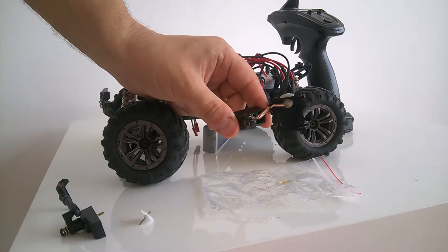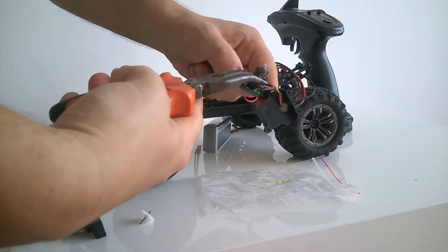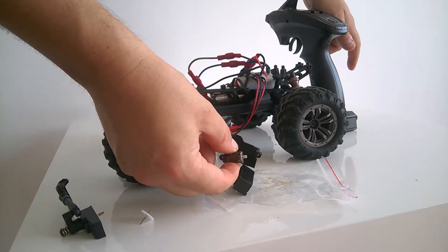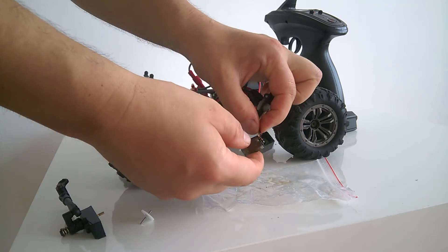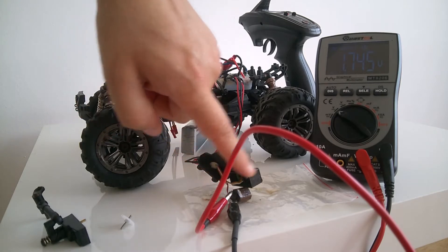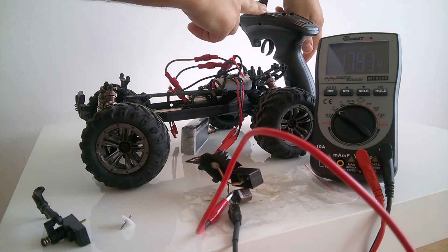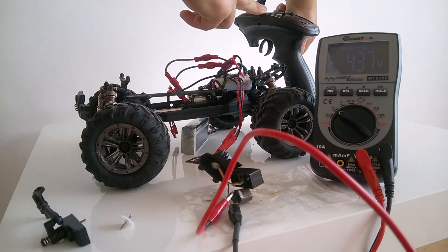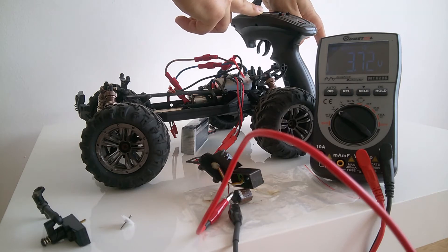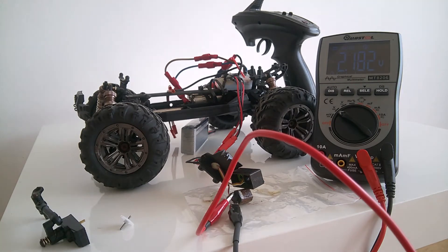Now I'll try to move it with the help of pliers. I can see a lot of rust and I'm sure the motor has been compromised. I need to check if there's any electricity going inside, so I attach the cables to the voltmeter and check by moving the steering wheel. As you can see, it gives us minus 4 volts and then plus 3.7 volts, so we know the cables are good and the electrical motor is currently bad.